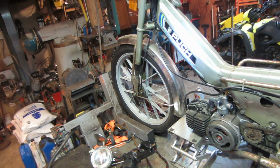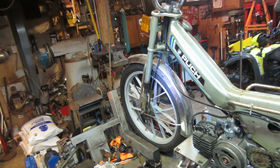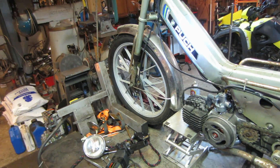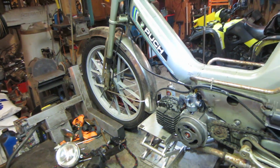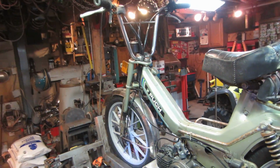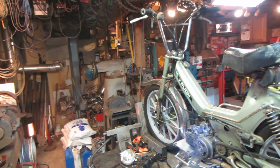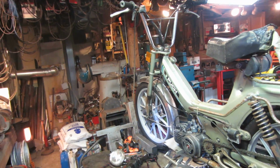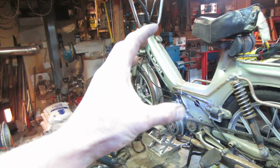Gas tank's I'm gonna allow it to still let that soak some more. And I think tomorrow I'm just gonna go continue just cleaning stuff up. And again, let the gas tank sit as long as possible. And then finally, once I do drain that, and I gotta dry it out, gotta neutralize it, get it dry, and then I have to coat it with the gas tank sealer,